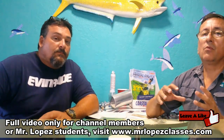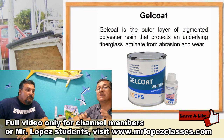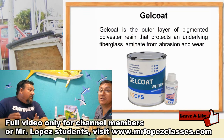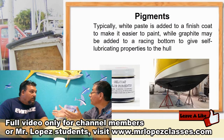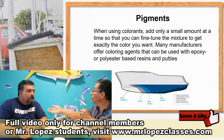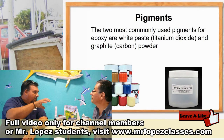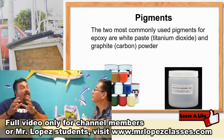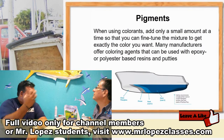Now we are going to continue with the gel coat — its function, how it's prepared, and some tips when you apply it. What is the main function of gel coat? Gel coat is just like polyester resin — it's polyester resin with pigment. You can pick the color you want. You can prepare the external paint of your boat by ordering from a specialty shop that prepares paints with the color you prefer. The only thing people have to realize is that on an older boat, the sun changes the pigment. When you try to paint it with the same color code, it's not going to match, so you may need a skilled painter to blend colors, or wet-sand the whole boat to expose fresh gel coat.